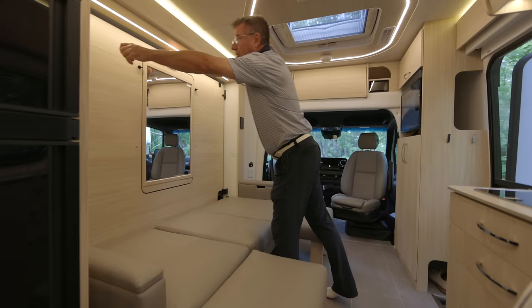You can sit underneath the awning, do some barbecuing, and have breakfast, dinner, or supper all outside in the great outdoors. Right here we've got a nice big storage area — you can see we had our golf clubs in there. More nice deep storage down below, galvanized sheet metal, all lined with spray foam. EPDM rubber hinge seal, locks in place. Next, we've got our optional generator: a 3.6-kilowatt propane Onan generator with auto-gen start. You can set it for time, or set it by electrical voltage so when lithium batteries get low it automatically comes on, charges them back up. It'll run your air conditioner and microwave all at the same time.